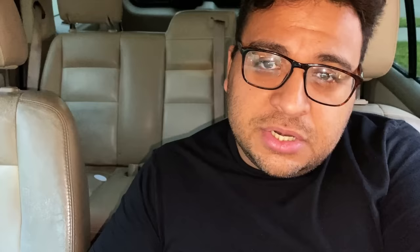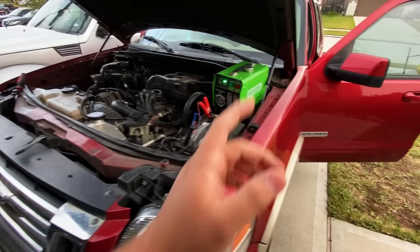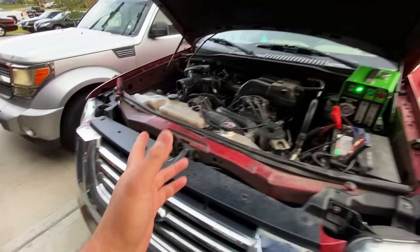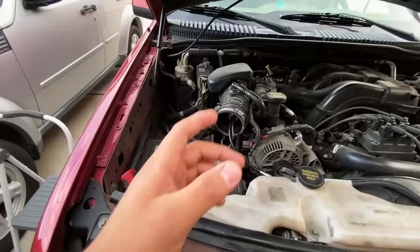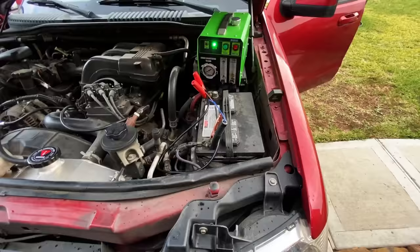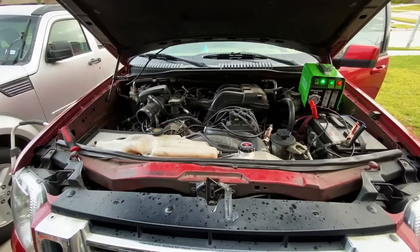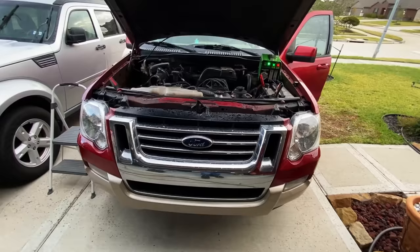Now that we know we're dealing with a vacuum leak, the first thing I want to do is connect the smoke machine to the engine and see if we can find the leak. I've got the smoke machine connected — today we're using the Mr. Car Tool, which you've seen on my channel before. I already went ahead and removed the air box. I'm using a little air bladder that blocks the airflow through the intake tube and gives us a port to inject smoke. The machine is connected to the battery and powered up. I'll click on air mode to activate the compressor, then smoke mode to activate the heater that creates smoke using the oil inside the machine. The system is now filling up with smoke.